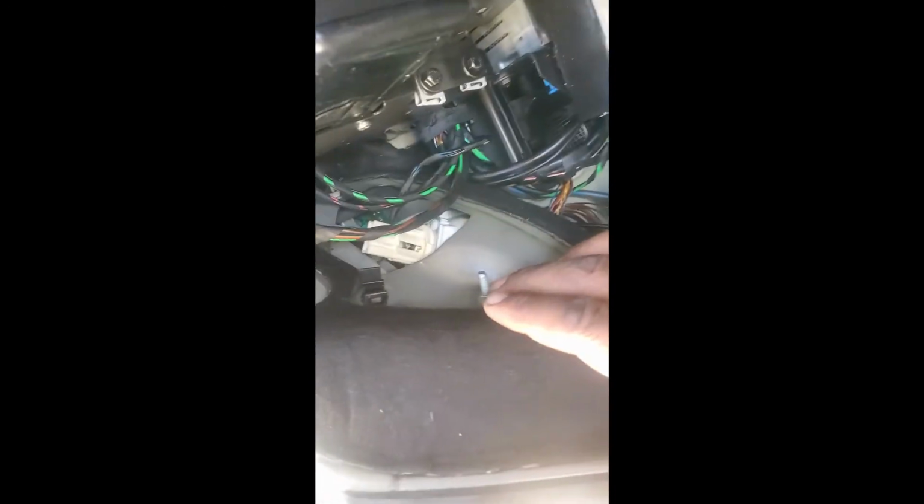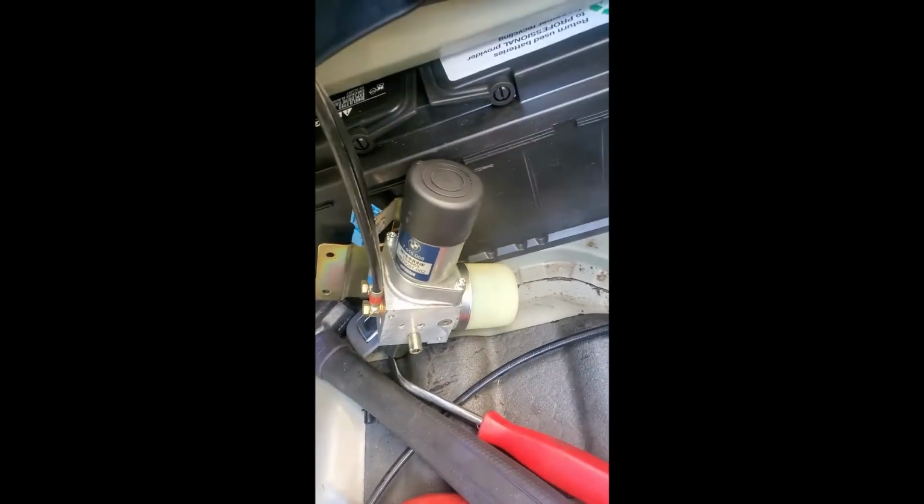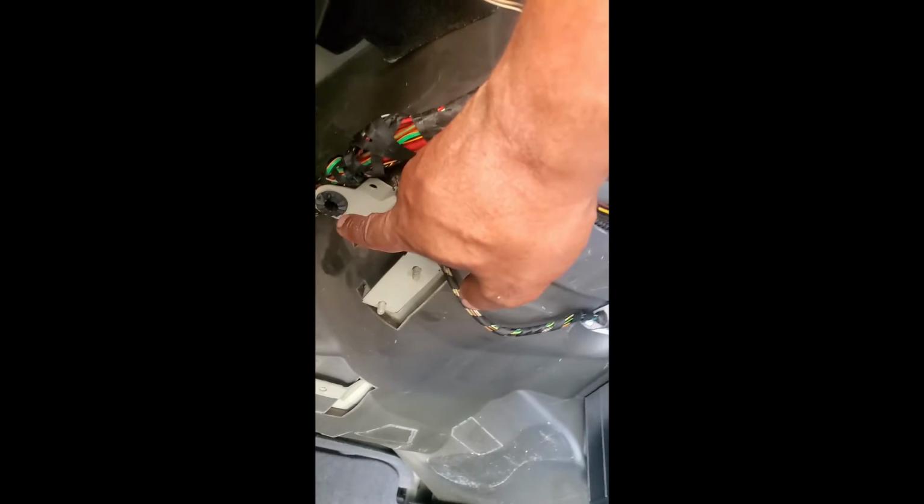This cylinder normally snaps on, I don't know if you can see it, all these clips. So there's clips going all the way around the trunk, here, here, and this line goes all the way around. I only took it halfway out. I stopped over here, so it's clipped in right here. I stopped over here, so we'll just have to take it out from around the back. And then the pump, which is down here, that we have to refill and prime and get all the air out, it mounts right here on these mounts. So those lines will run here and go behind this, and then drop down and around the trunk and mount on that side. So very simple.